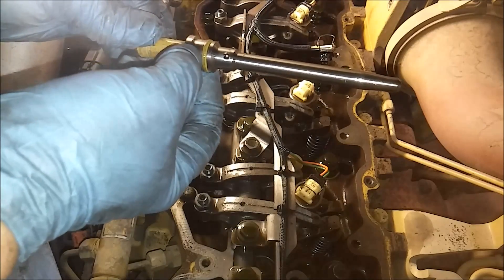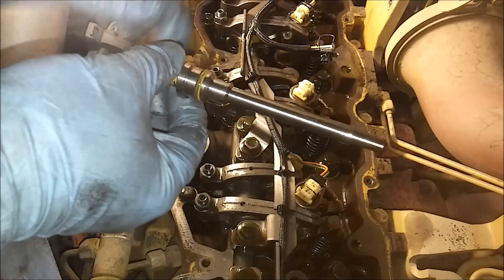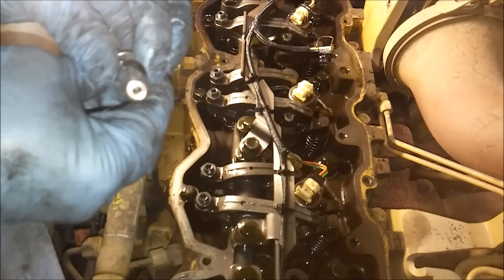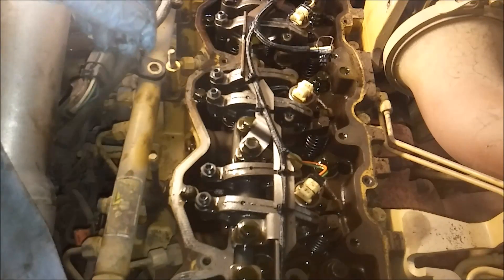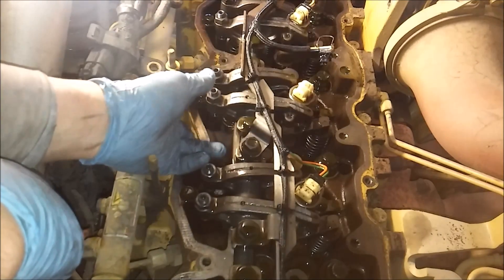And there's your quill tube - you can see the yellow seal there. You can replace that. And you'll see there's a little ball - that's an alignment dowel actually. You're going to check your sealing surface of the quill tube - make sure there's no flaking or damage to it. Other than that, it's reusable on the Cats. I believe on the Cummins they are not reusable though - check your manufacturer for that.